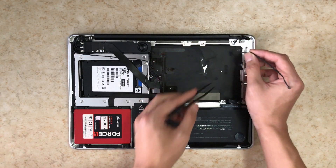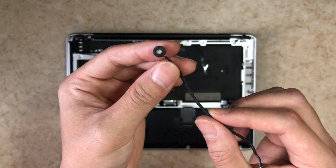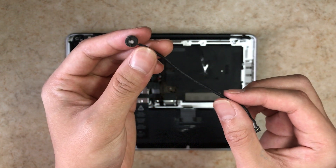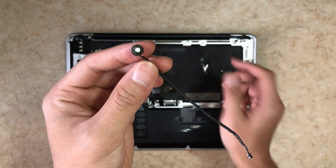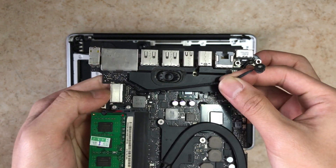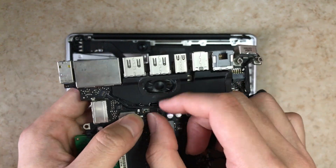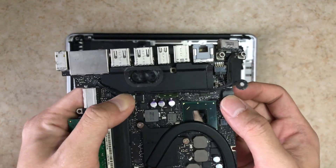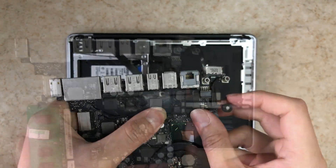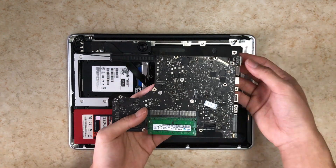I was finally able to remove my microphone from the chassis, even though I had to break the glue. If you manage to remove yours you don't need to do this, but here's how: clip the end of the microphone to the motherboard, then put the cable back along the lines of the speaker. Now we are ready to put the motherboard back into its chassis.